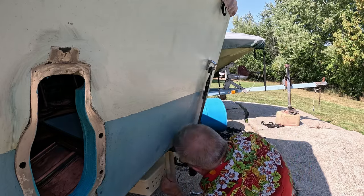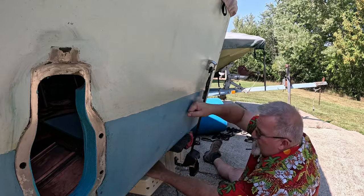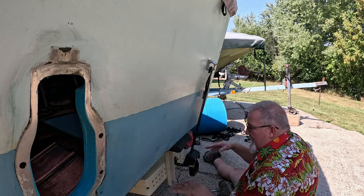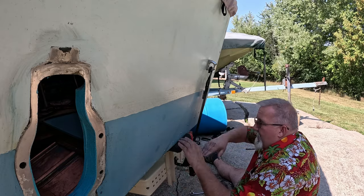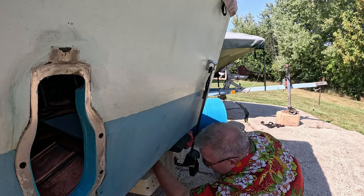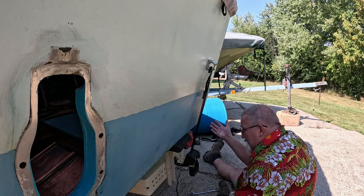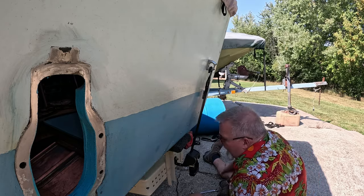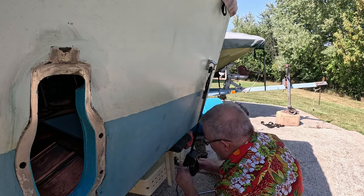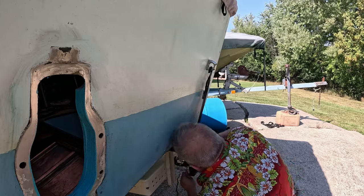And keep in mind, the only thing this is trying to do is create some more friction, but it's also keeping the boat from hopping and separating from the trailer. Say you're going around a corner and you hit some bumps and it's a little sharp and this thing pops up off the trailer. I've got these bunks on the outside of my chine that runs the full length of the boat. So that's going to help prevent the side to side. Plus, if it goes crazy sideways, it could hit my fender. It could be another, what's called a fail-safe point. Not a good one. But let me finish tightening this down now that I've got some tension on it.